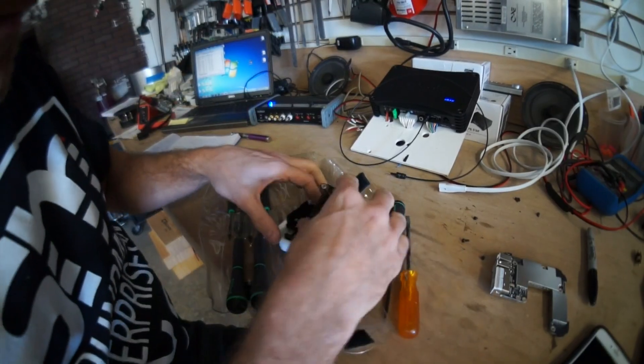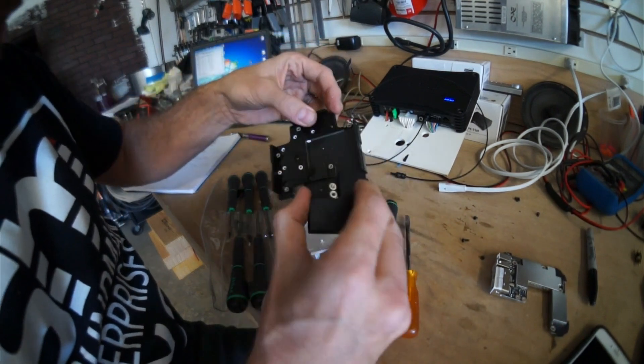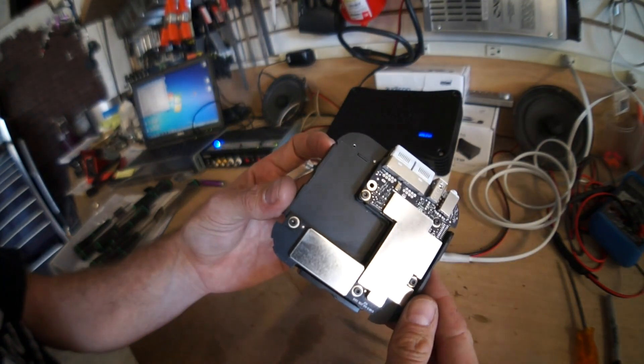I had the Airport Express taken all apart and it has this cool little aluminum plate that I could use to mount to my plate. There are two slightly longer screws that I'm going to salvage — a couple of these holes are threaded all the way through, so I can flip the longer screws and thread right into this aluminum plate. I have to be careful of this optical cable because you can't kink it — the data is traveling over light, and if you kink it, the light is going to get disrupted and reflect off the wall.